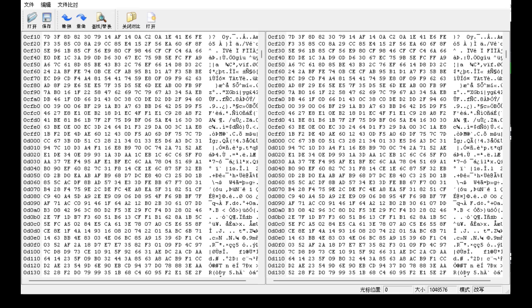They're all £7 programmers and they do work well, but do the mod, set it up for 3.3 volt, not 5, because that certainly is going to damage the NOR. Right, let me just hook this out of the way and we can get this other thing put back together. I'll have that off. Right, so that's the original board. I'll leave that with that programmer at the moment. That's the original board. Now there's the one I've reprogrammed. Heavens knows, it's here somewhere. Let's go back to the camera. What do we want?